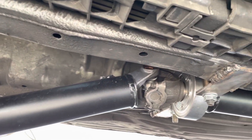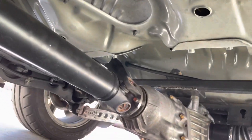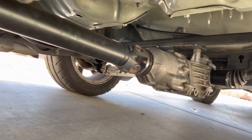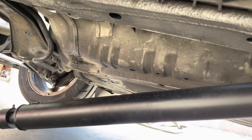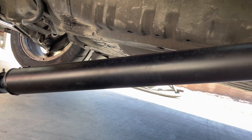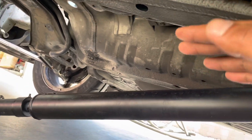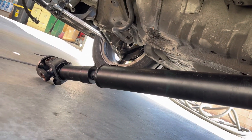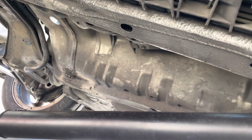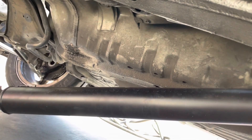Here's the rest of my driveshaft and how I was able to install it, using the CR-V rear diff. We do still need to add our OEM driveshaft strap, because when you're driving, if something were to ever malfunction, you want your driveshaft to stay up and not drop down to the ground — that can become quite a bad thing. Once I get it back running, I'll be adding my strap so if it ever drops, the strap's going to hold it up.